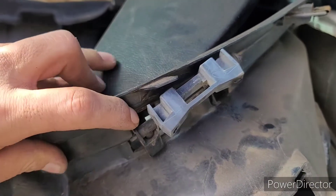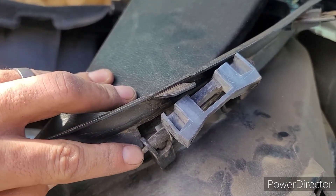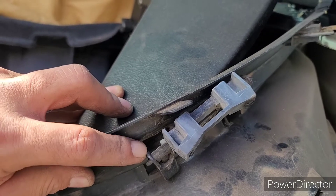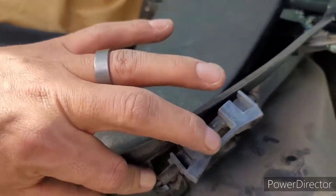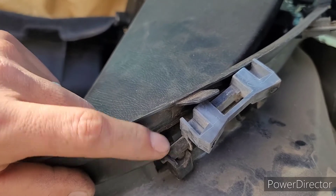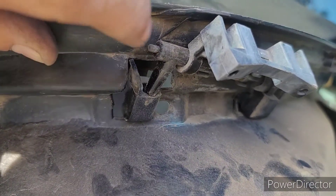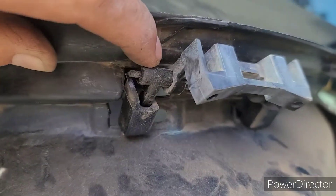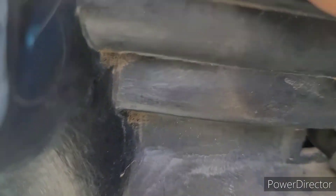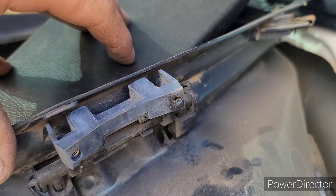The only part that's left is this piece right here. You're going to have to shove this over and get that little nipple out. This is the only way I figured out how to get it out — I don't know if there's another way. Just get this up, because if these are brittle or dried out they're going to break, but these are flexing a little bit. See, I got that out. It has this piece dropping down and falling in that hole, so you can't just lift it straight out. After you get it past that piece, then it'll come out. Same thing with the other side — push that over and it should come out.